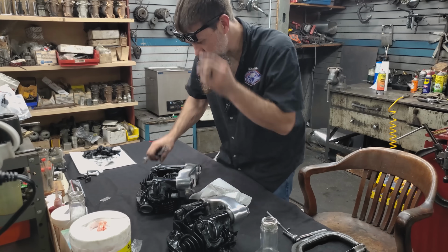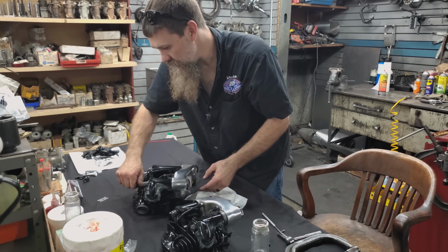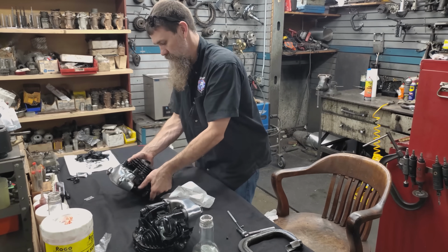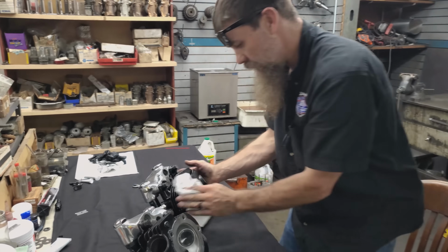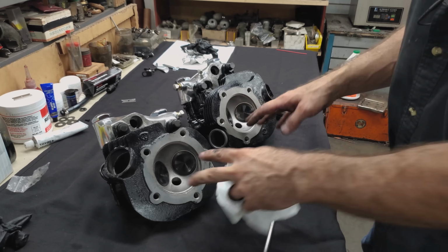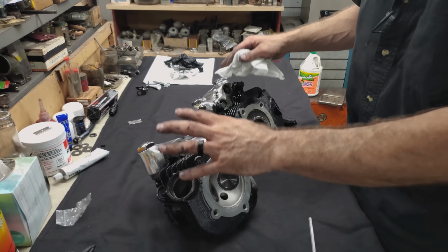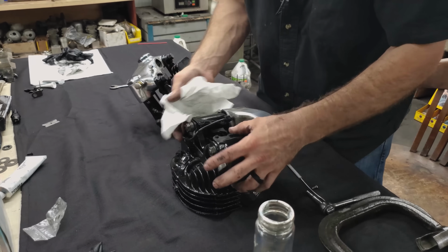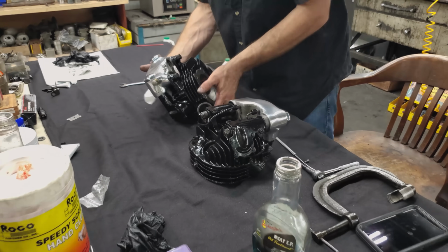All right, guys. Well, there you have it. A genuine pair of 1937 Harley-Davidson Knuckleheads, all assembled, looking fresh. As you can see, combustion chambers. Look at the inside there, Steve. Everything's looking just fantastic. Like I said, new Kibblewhite valves, original Harley-Davidson rocker boxes, rocker arms, rocker arm shafts, original Harley-Davidson valve spring cups, the retrofit type that keep the top end dry, original tin tops.